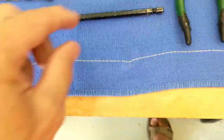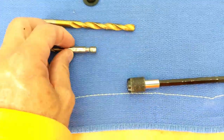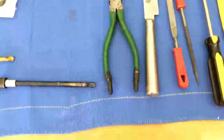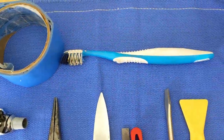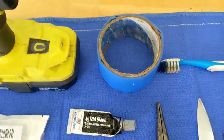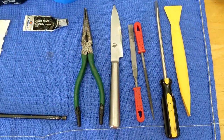This is a seven millimeter chuckable hex head bit on an extender, just to make it easier to get in there, and I used a nut driver rather than an actual drill. You do need to clean things up prior, so I just used a toothbrush and some painter's tape just to protect the area.